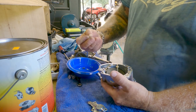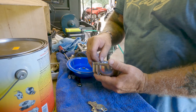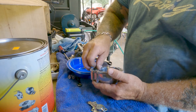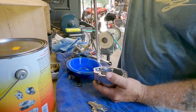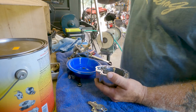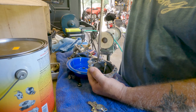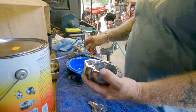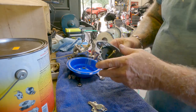The fuel lifts it up, and as the fuel lifts it up it pushes this down and it shuts the fuel off. So if you have gas running out of your carb, the chances are the reason why the gas is running out of your carb is because either the problem is here in your float — it's either sticking there or sticking here. It's a real simple fix. Just tighten this down, slide that over just a little bit. Tight enough, and then that's it. Let's see — it's got good travel. There you go.